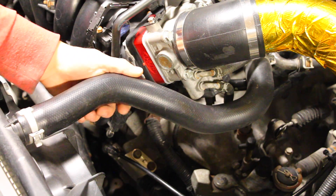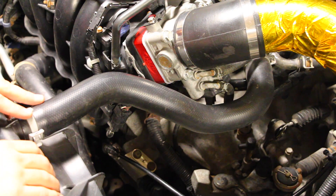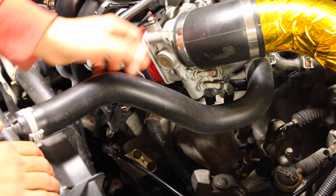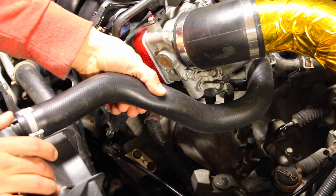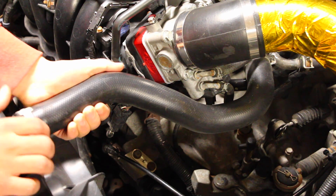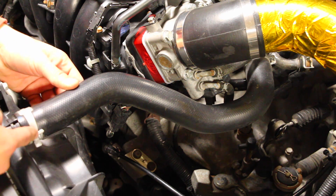Right here is the upper radiator hose that comes from the engine through this hose up to the rad. To inspect whether it needs to be replaced, first let the car warm up then let it cool a little bit — just so the coolant isn't hot but it's warm. At that point the hose is going to be slightly flexible and you're just going to check for any kind of bubbling, any holes, any leaks — maybe around where it clamps on from the hose to the rad.